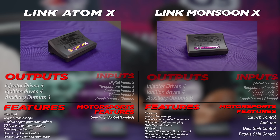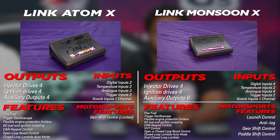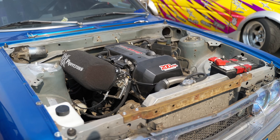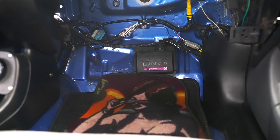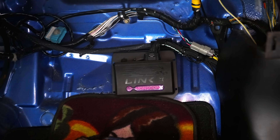Okay, so we're going to start down here. If you got champagne taste and you got beer money, we can start with our Atom X and the Monsoon X. These two are going to be very close in feature sets. The main thing that's going to be different is that the Monsoon X has an internal map sensor and also has a couple more inputs and outputs compared to the Atom X. Most commonly, these two are used for four-cylinder engine setups. Typically, if you would do a four-cylinder forced induction, you might choose the Monsoon. But they could also be used on a V8 or V6 if you're okay with using wasted spark and group injection. So do you think you're going to need more than four analog inputs that the Monsoon X would provide?